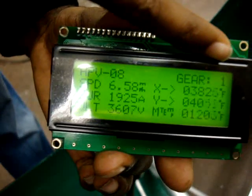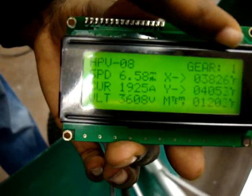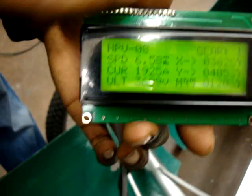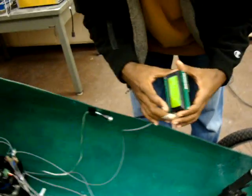We also keep track of what gear we're in — every time it shifts, it triggers here to tell you which gear you're in. Here's our throttle. There's a Hall effect speed sensor in the back, and every time it rotates, it determines the RPM based on the lag time between each pulse.